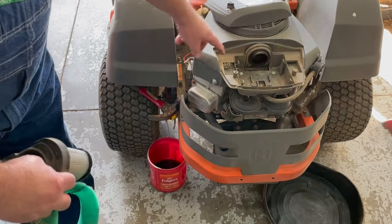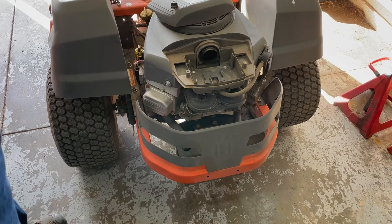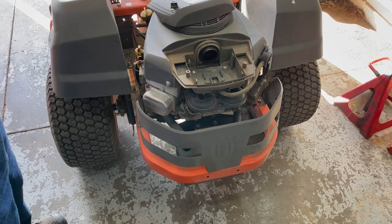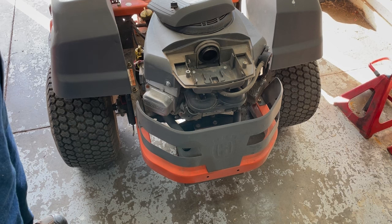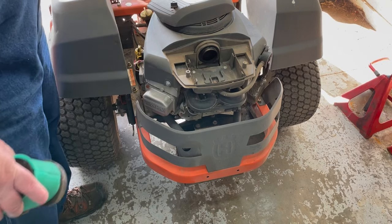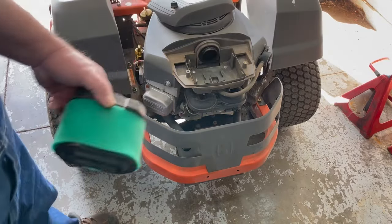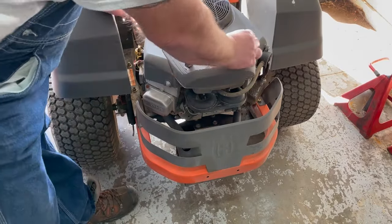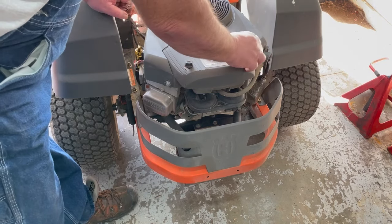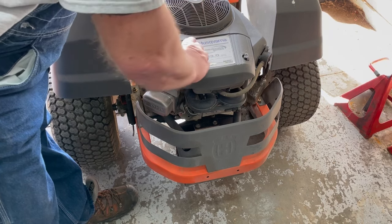Blow this out in here real good. When it's done draining oil, we're going to change the oil filter, put new oil in there, and we'll see if we can't start her up. This guy's done putting the battery in. Charges on 2 amps when he charges these lawnmower batteries — don't use the 6 amp or nothing. No higher than 2 amp or a trickle charger. The slow, steady charge is a lot better than the fast one on these lawnmower batteries. I cleaned out the air filter compartment, blew out the filter, put fresh oil in, new oil filter, replaced the spark plugs and the fuel filter. I always do that on a spring tune-up so that way when they're ready to mow this summer, all they got to do is turn the key and go.